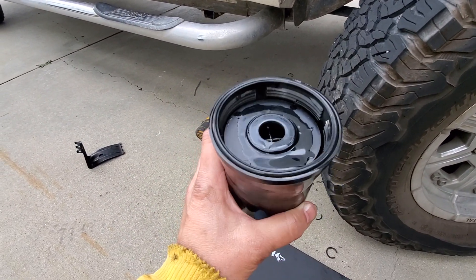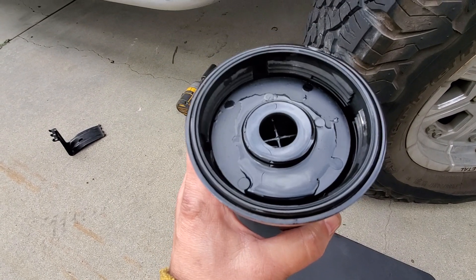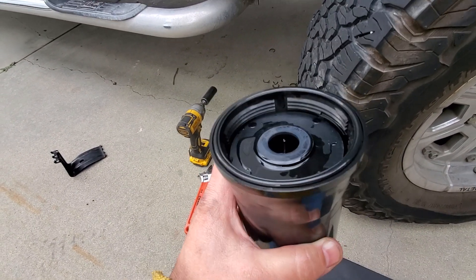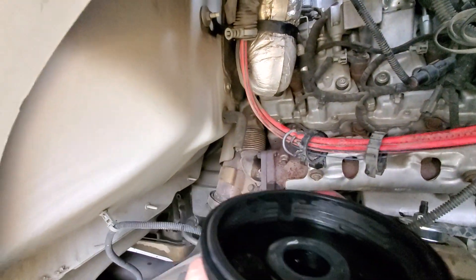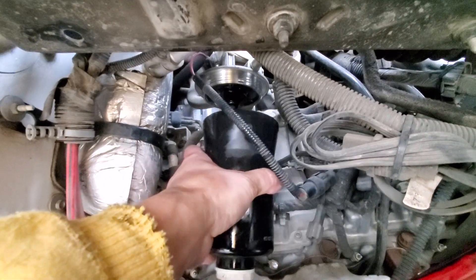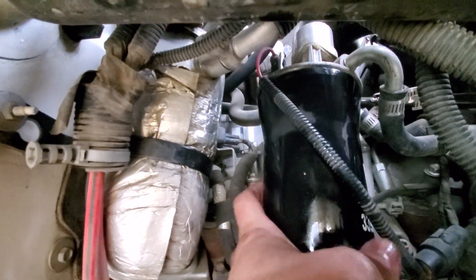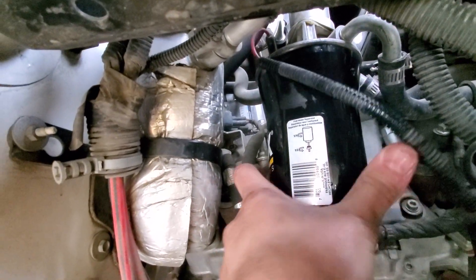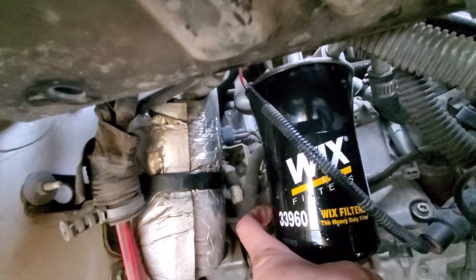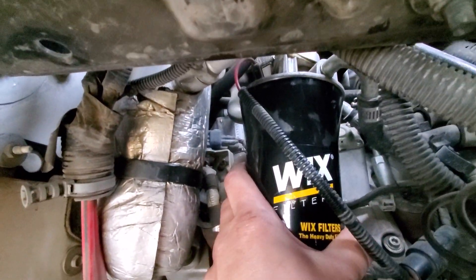What I did was put some of the diesel fuel back in there. I didn't show it in the video because I didn't have two hands, but I take a cheesecloth, put it over the cup — most of the crumbs and debris will settle at the bottom so it's all clean fuel that goes in. I'd recommend doing that to be on the safe side. Now I've got my housing right there — we're just going to screw it up on that. Make sure you put diesel fuel on the o-ring, just like doing an oil change.